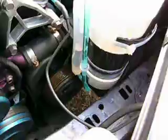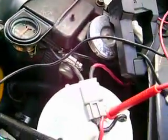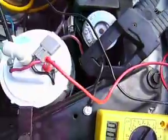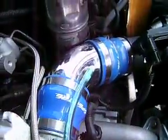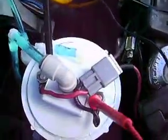You can see a bit of the mount I made and how it's situated within the engine compartment. It's a little closer to the radiator than I'd like, but as with many installations, space is an issue and this happened to be the most logical place. There is a hole right underneath the radiator support so some cold air does circulate around helping cool the unit. The output hose traces right to the intake ducting as close to the throttle body as possible. Wiring is 10 gauge.